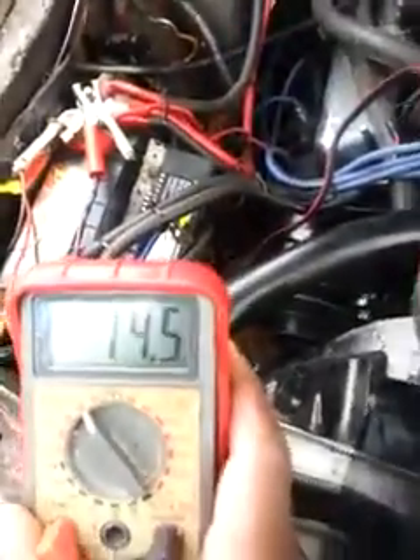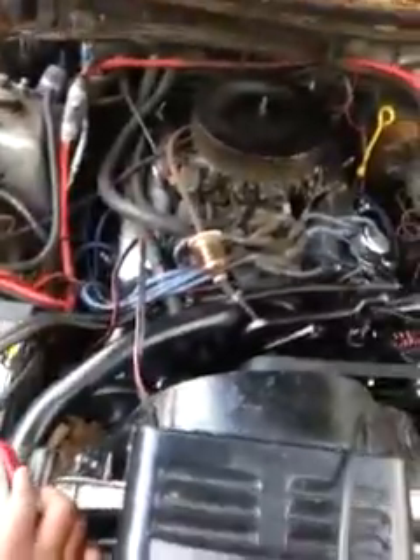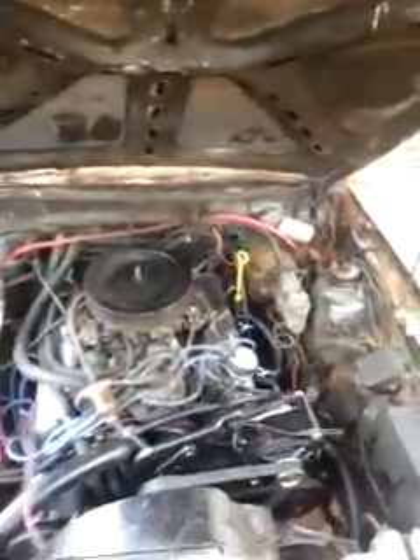Right now the car is not fully charged because I've been sitting here playing with my system. It's really like 14.5 right now — I've seen 14.7 up front. Both alternators sit at 14.8, but I've seen it drop from 14.7 down to 14.1 with everything on, and that's damn good because I've been in the 11.9s and 12s. Now I'm up in the 13s and 14s, so that sounds good to me.